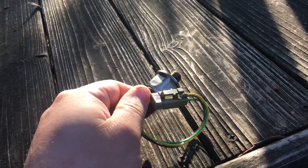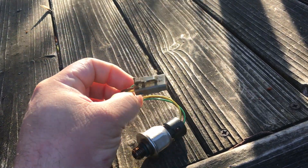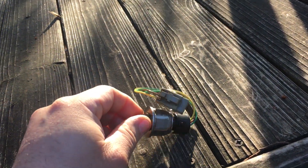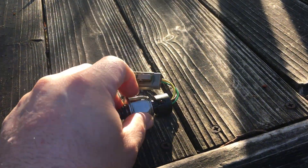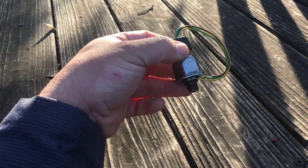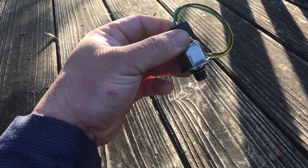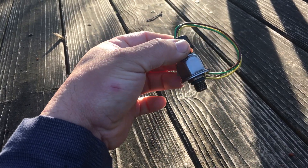As you can tell, this sensor has a connector right here. You might be wondering where does this go — well, this sensor goes inside your actual head. It sits at the very top of the high pressure oil rail. Oil is sent through here, and this is what makes your truck start. How do you know when this sensor starts going out? Here are some symptoms I've known throughout the years from my own experience.